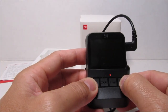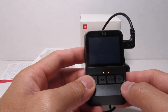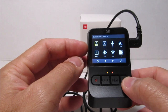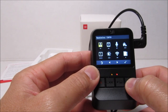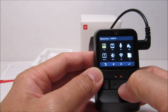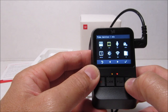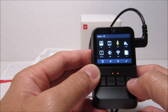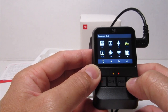Let's check out the settings. To turn on the dashcam manually, push and hold the power button for a second. To get to the settings, push the button again. First in the settings is the resolution — it defaults to 1080p at 30 frames per second, or you can lower it to 720p at 30fps, which I don't recommend. Then we have the video duration — video clips can be one minute or three minutes long, so basically the camera will split the footage into one or three minute segments. Then we have the mic on or off.